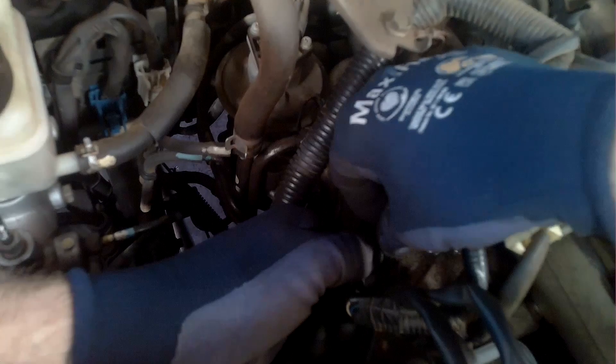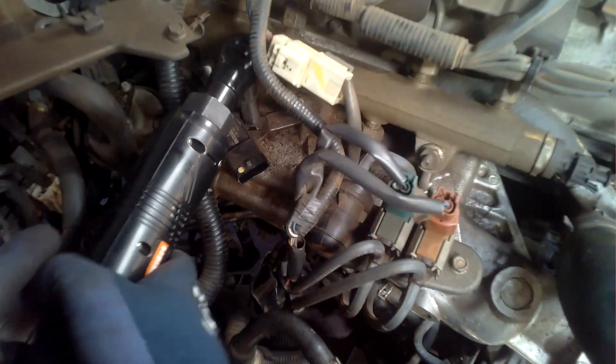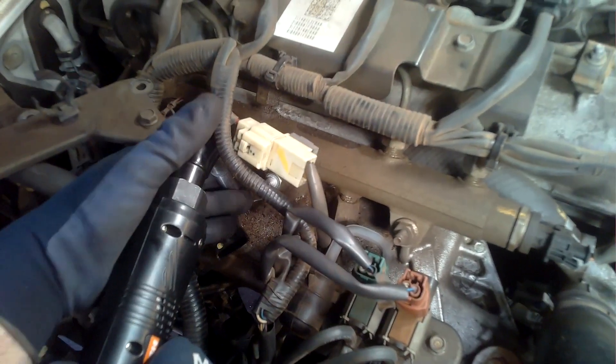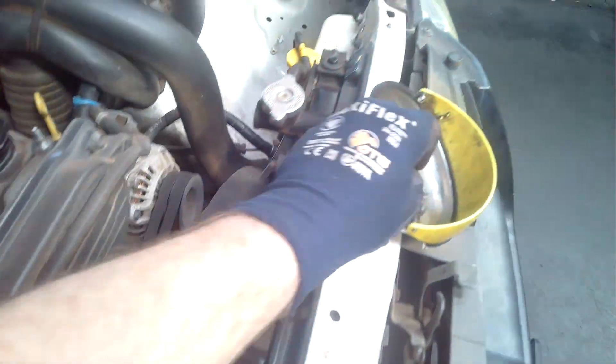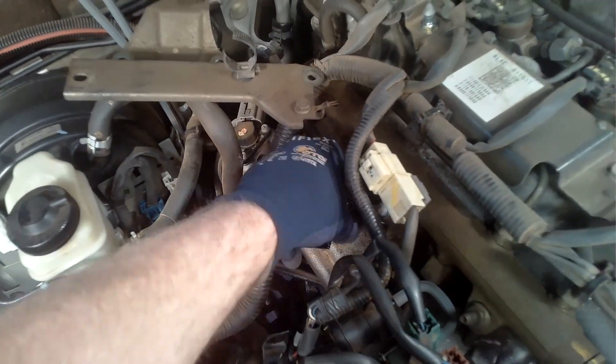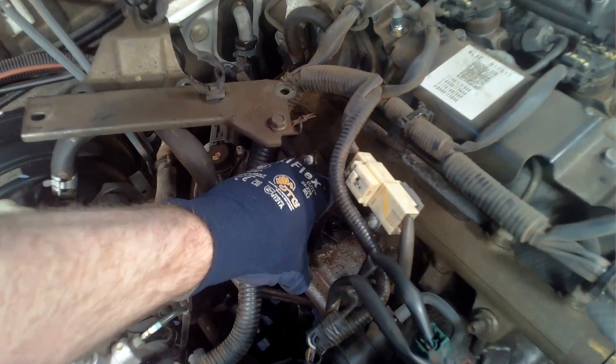Back at the workshop I do the simple task of gaining access to that MAP sensor to inspect it. I also do off camera some quick checks on the actual wiring of that sensor, which all showed up fine. I have an in-depth MAP sensor testing step-by-step video which I'll link in the description. The sensor is just removed — I wanted to see how heavily carboned up it was, and in this case it actually was. These are very simple to gain access to; it's just a simple bracket that needs to go out of the way.